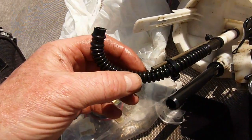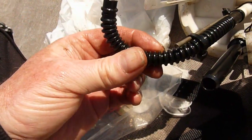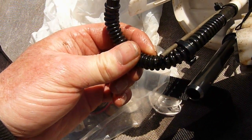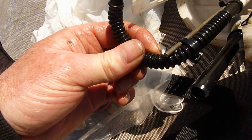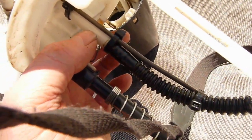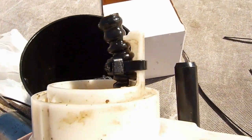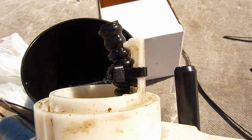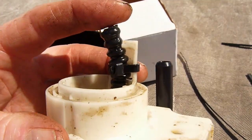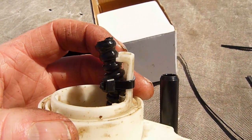At the bottom, we need to trim off the bottom of the flexi pipe, leaving sufficient on the bottom so that the pipe bends to the side. This will prevent the bottom of the pipe from actually being blocked. We now need to bend our wire so that the tube actually goes down into the pump housing. This is how the end of your pipe should look — secured with a cable tie, so it stands proud of this clip which fixes on the rim of the old pump.